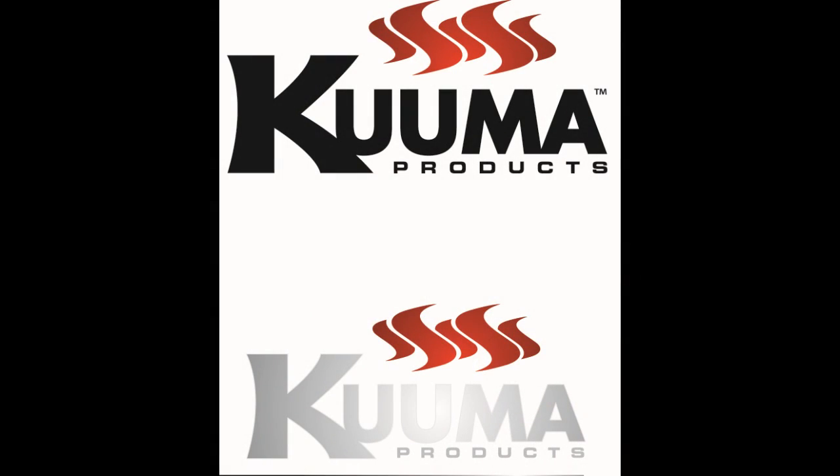If you have any questions or aren't sure of something, check with the professionals or have this professionally installed. On a side note, small amounts of DC electric current do move between the boat and the shore, so to prevent galvanic damage it's recommended you also hook up a galvanic isolator.